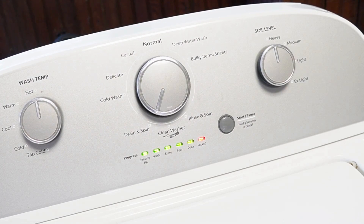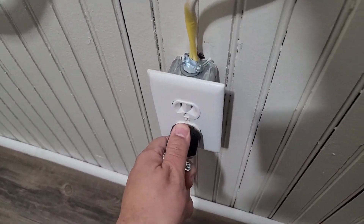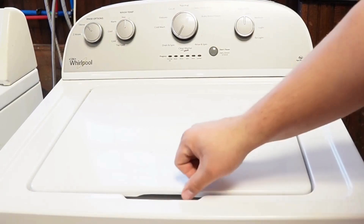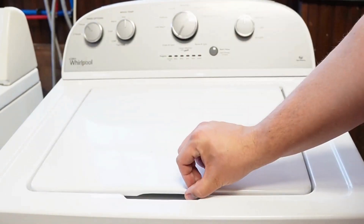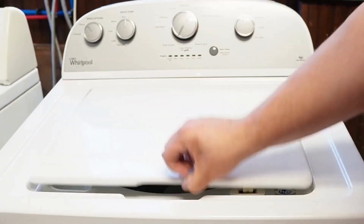When the calibration mode is at the end, every single light is going to turn off, including the lid lock light, and the machine is now ready and recalibrated for use at an optimal level. Now let's try one more reset technique. First, unplug the washing machine and let it sit for about one minute to drain any capacitors or memory, just like we did the first time. Then plug the washing machine back in, let it sit for a few moments, then open and close the lid six times in under 12 seconds. This works on some but not all models, and it will issue a reset command to the washing machine to clear any issues beyond what the reboot or reset mode did.